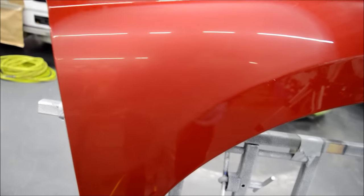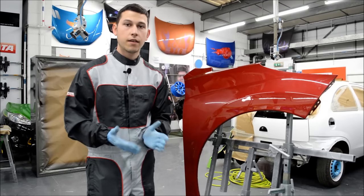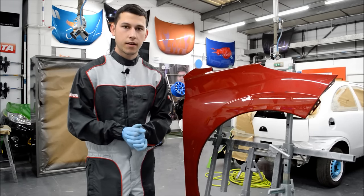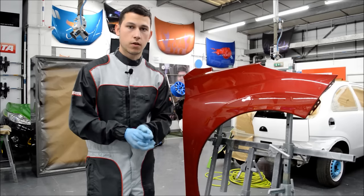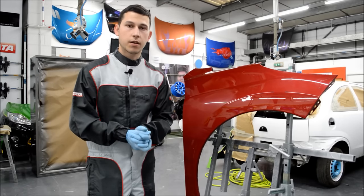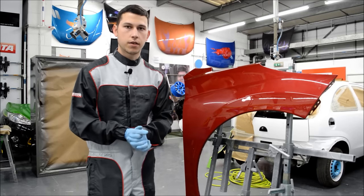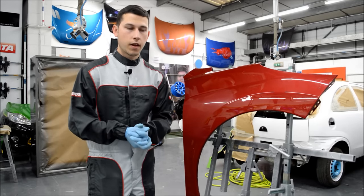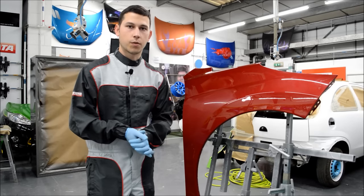The 6000 is great for use on dark colours and blacks. That's it for this video on machine sanding. I'm going to put together a table of what grades of abrasive to use whilst polishing — hopefully it'll be some use to you. I'll use some pictures from this job today, so it should give you a helping hand of what grades to use and how to use them. I'll put them on the end of the video and also put my website. Thanks for watching.